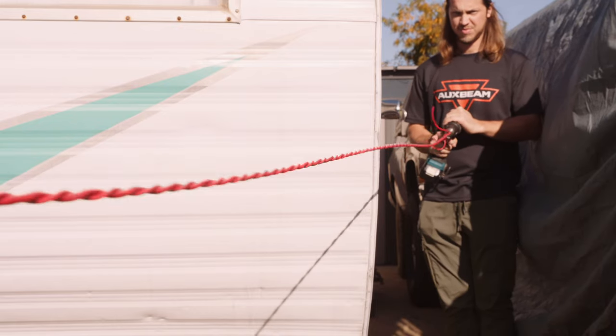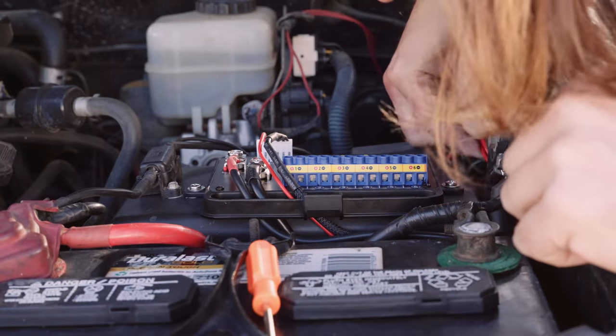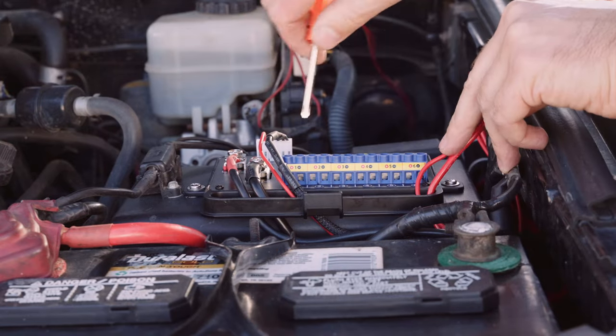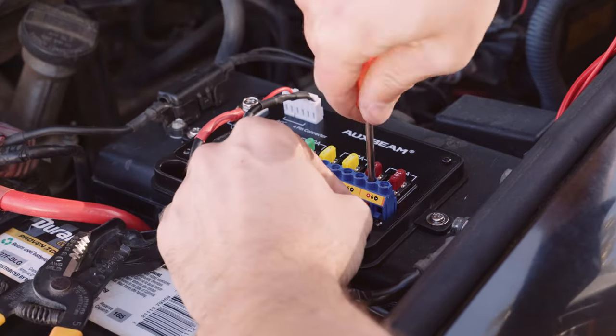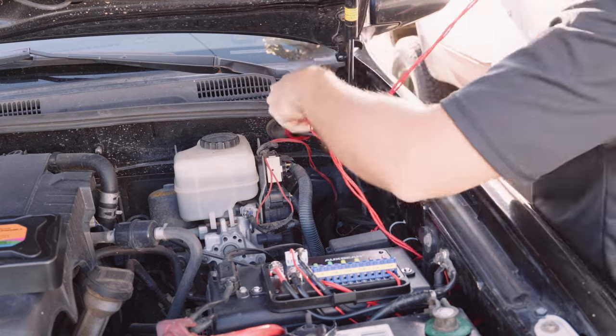Be sure to look up a wire size chart to make sure you use adequate gauge wire to power your gear and also connect your items to the correct amperage channel in the fuse box. If you run to a fuse that's rated too high, or if you use a wire that's too small, it'll increase your risk of fire. So take wire size very seriously.